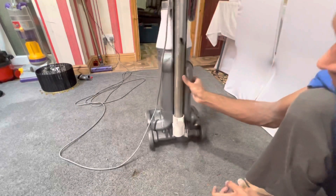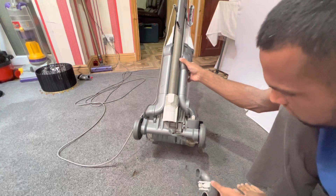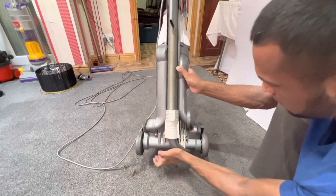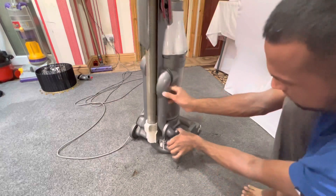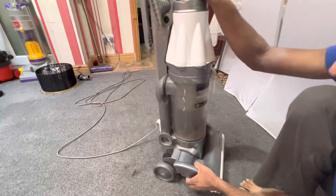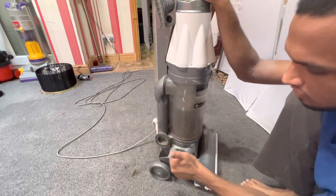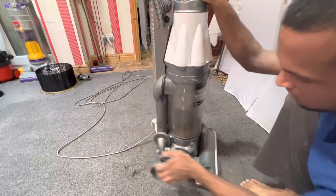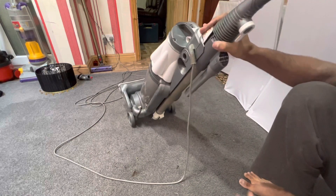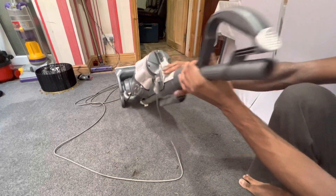When I was trying to use the hose it was basically blocked — it wouldn't suck up anything. Let's check the U-bend and see what's in there. There's a screw in there but nothing actually blocking it, so let's check further up. Valve pipe — no, that's all clear. Let's switch it on here; it will probably have suction because the head has suction. The problem must lie in the actual hose itself or the wand.